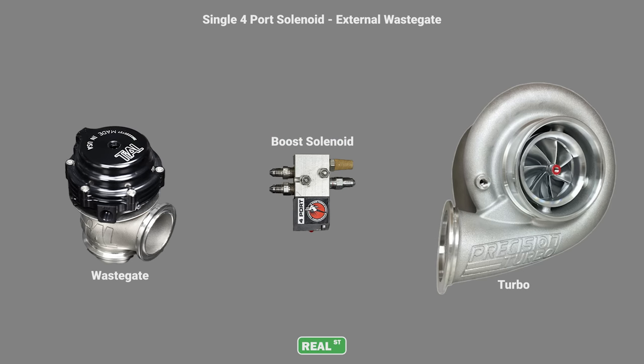In this diagram we have a single four-port wastegate solenoid. The four-port is different from the three-port in that the four-port is going to be manipulating both sides of the wastegate diaphragm — decreasing boost signal to the bottom while increasing boost signal to the top. A system like this will make maximum system pressure and have a very wide range of boost available, however it comes at a cost: small amounts of wastegate duty can equal large amounts of boost pressure change.